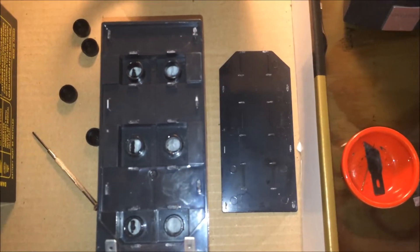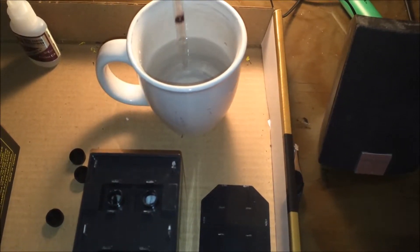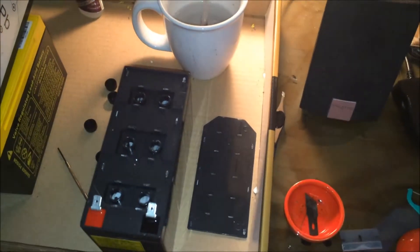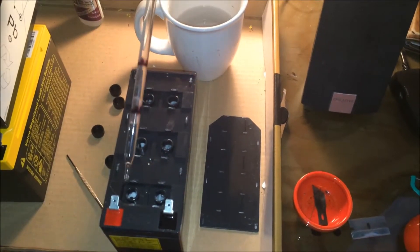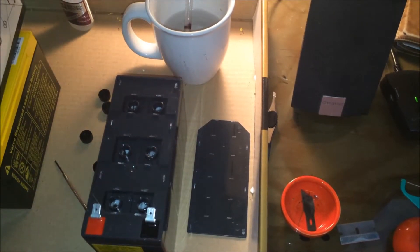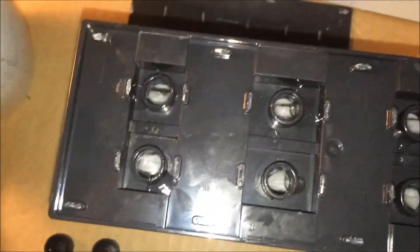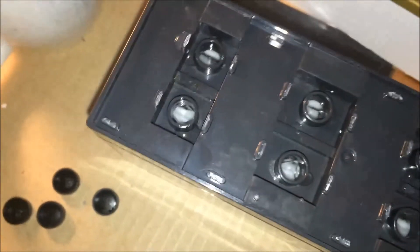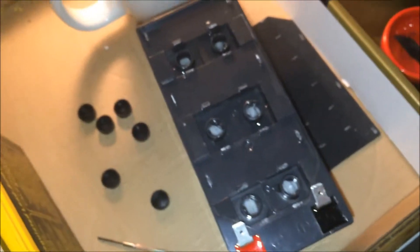This is distilled water, a ceramic mug with a glass pipette, and a rubber stopper bowl — all stuff that won't get dissolved by sulfuric acid. You just slowly fill it up; you don't want it overflowing, you just want to cover the plates. It's fiberglass batting inside, so you just want it to absorb like a wet sponge rather than a jug of liquid. So it's all filled with water, just barely covering the plates. I'm going to let it sit for a day, then charge it, then cap it back up, and it's going to be part of one of my three battery packs.